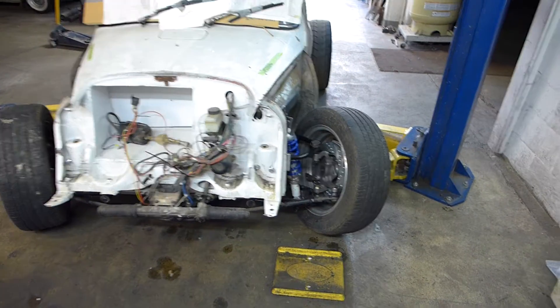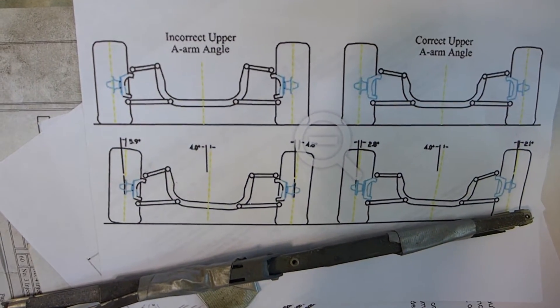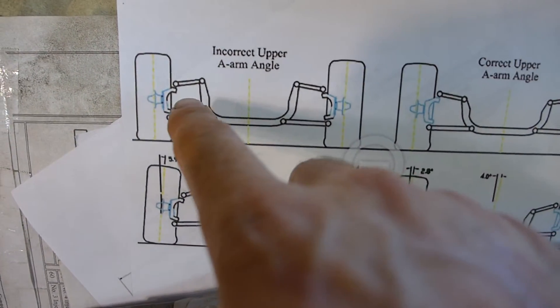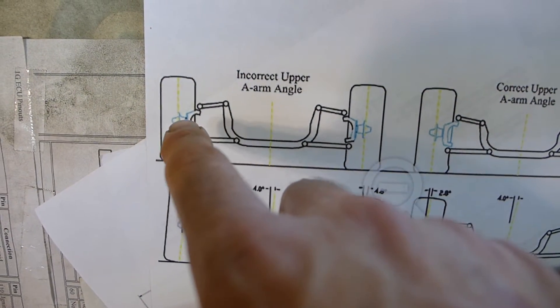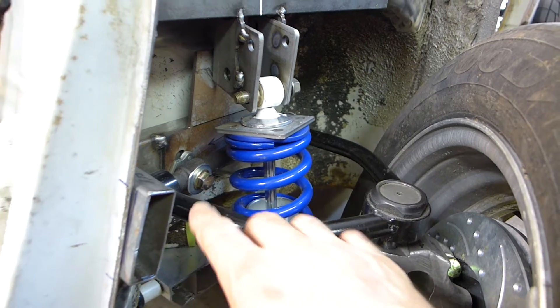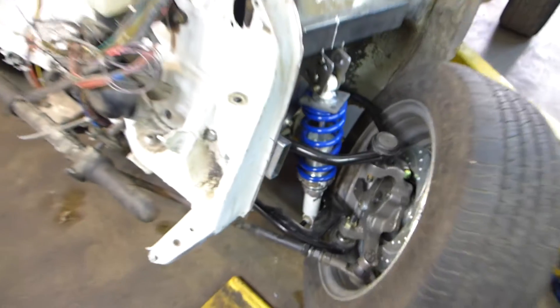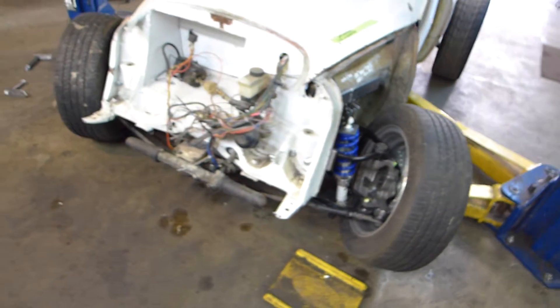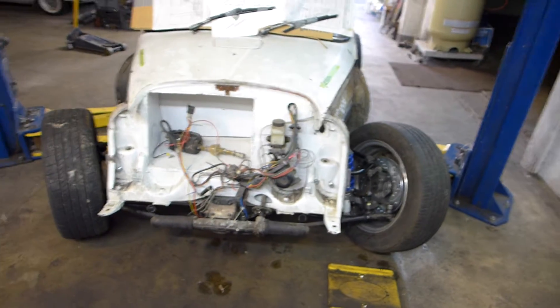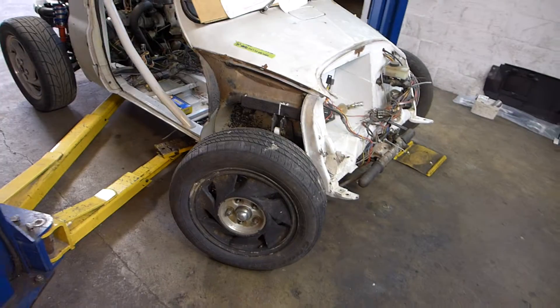I've also realized through my control arms that the upper control arm goes down to the ball joint or the wheel, and it needs to be the opposite way. So I've got to make some adjustments and go back and actually lower my caster point so that my control arm goes down — that way I don't have a problem when I'm steering and it keeps the rubber to the road, as they say.